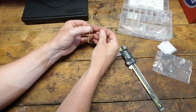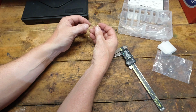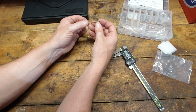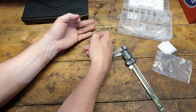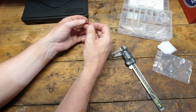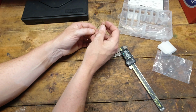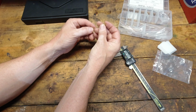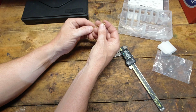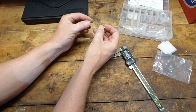On the jet here, the way it rides in there is, even with the spring all the way down, there's only so far the rod can go. It will bottom out in the bottom side of the carburetor. That's why the overall distance and length of the rod are very, very calculated. And the piston is going to restrict some of that, but the problem here is I don't know that you're going to get out of that transition. If that's all the way down and it's on the fat side of it, I think this jet is going to stop right in the transition point.